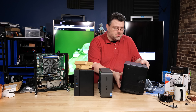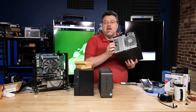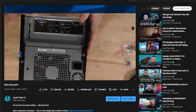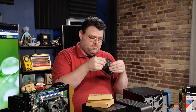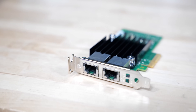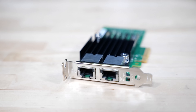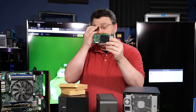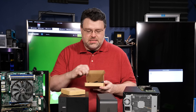Finally, Supermicro. I've done some videos on Supermicro servers — this is a six-core Xeon-based system. The motherboard has two built-in one-gigabit NICs. You can of course add a 10 gigabit half-height card — boom, look at that. Intel X550, half-height, dual 10 gigabit connections, taking up a PCIe x4 interface. But you know what else is PCIe x4? Your M.2. Check this out.